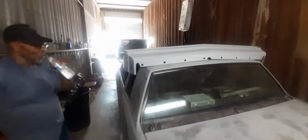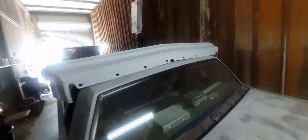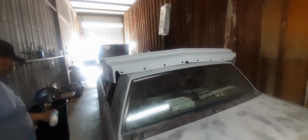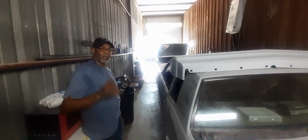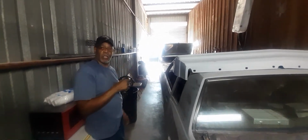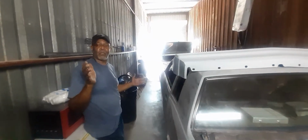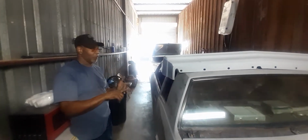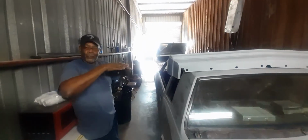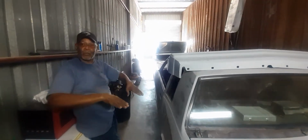I was telling them I gotta get this absorber to go behind this bumper so I could get an accurate fitment on it so I can fill in my highs and lows. Can't fill it in without an absorber behind it. The reason why we put those back there is, when I worked in Michigan, it was cold all the time, so it never shrunk, it never sagged. But if you go to Florida, Texas, California, without that, within 3 months the bumper will take a dip and start to sag right off the car.